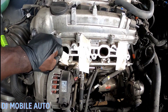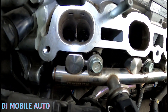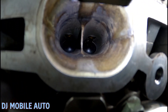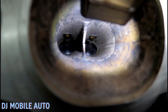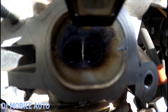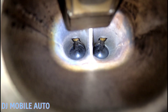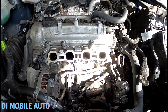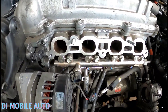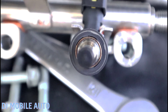That completes the mission. I'm going to remove the tape. The vacuum did suck up whatever walnut media was remaining — for the fine pieces I had to push the vacuum deeper to get those up. It's not too bad at all. Let me get a brighter light in there — yeah, it's looking really clean. This will also help air pass and flow properly across the runners and the valves. I think that's done.